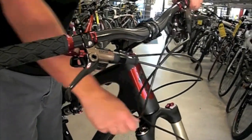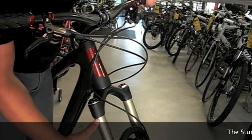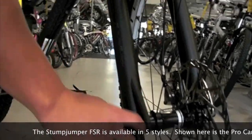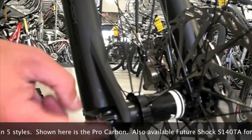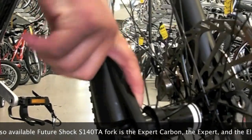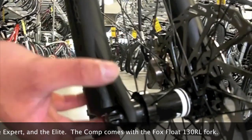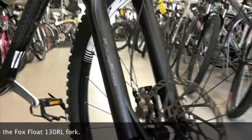Turn this back to long, and you can see it expand — giving you the original 140 millimeters of travel. The front hub is also mated to the fork with oversized cups. So you're getting a lightweight setup of a quick release, but with the stiffness of a front fork similar to a 20-millimeter through axle. Basically, you get an oversized interface between the hub and the fork, providing great steering and precise placement of the front wheel.